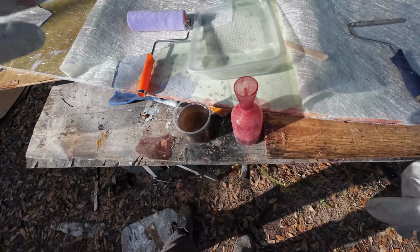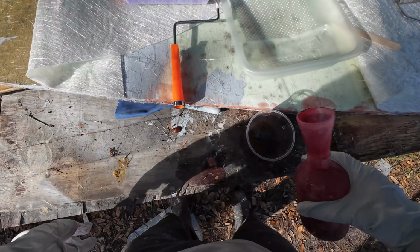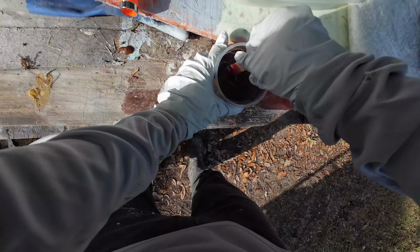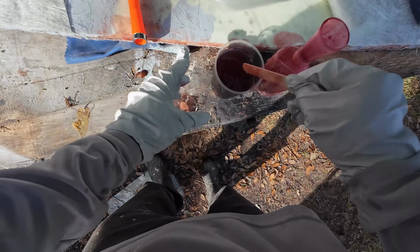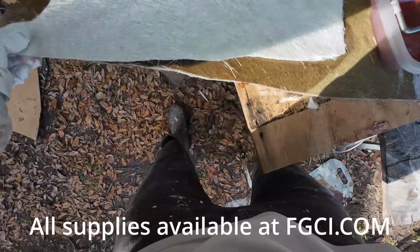All right, I'm gonna start with the tip up here with the bow area. I got my low profile resin. I catalyze at 1%, that's 10 cc's, well really 9 cc's, but we'll start with that. And I'm gonna do it in pieces because it's a lot easier that way, instead of laying out the whole thing, kind of pressured to hurry up. But let's go ahead and roll this out here. We'll pre-wet it. We wanna wet this out, and then let's put this guy in here.